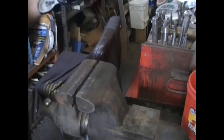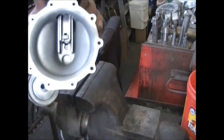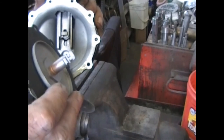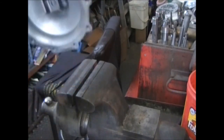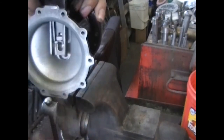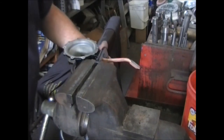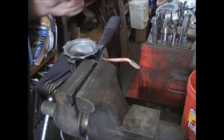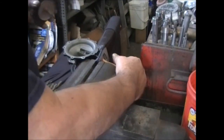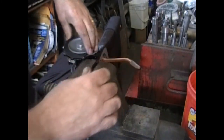Once you get four of them done you can release the pressure off that and then go around and tighten the rest down. A quick way to do a sort of a half-test: with the arm relaxed and the bowl on, hold your finger over the inlet and pull the arm up to check the outlet. Pull the arm up, block off the outlet, and let the arm go — that'll tell you that everything is sealed. Now we're going to go to the back inside — same idea as the other one. This has a big washer on the bottom, and it also has that copper washer — make sure that goes on first. Then the next size plate, the diaphragm, the big plate, another octagonal washer, lock washer, and a nut.